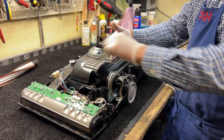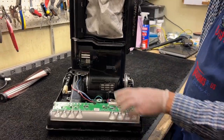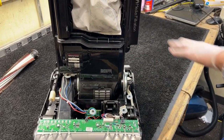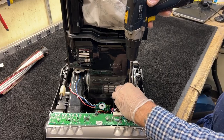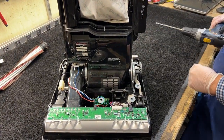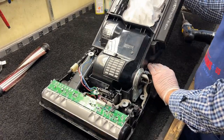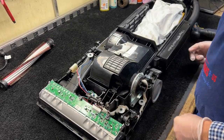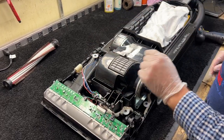I'm going to stand the machine up because there is a loaded spring right here — a spring assist to make the machine not weigh quite as much when you're leaning it back. It needs to be in the upright position to take off that spring assist. If you take it off while it's in a reclined position, the spring assist is loaded and it's going to pop out at you. This little thingy falls out sometimes — not a big deal. It just goes right back in there.